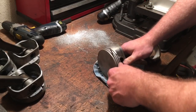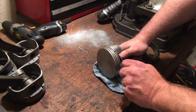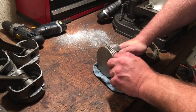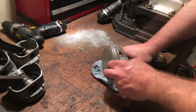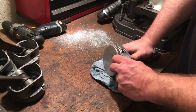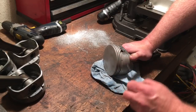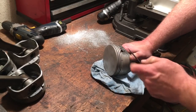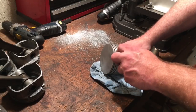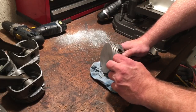This does two things: number one, it makes sure you have a clean piston groove to receive the ring; and also it makes sure you have no damage like a collapsed groove, burr, or anything that would keep your ring from moving freely. If you run into a little black spot, the tip of the file will get it out. Same thing here — start with the factory oil returns because you will find burrs coming up out of that factory oil return into your oil control ring land. Don't be dismayed, just clean it up with your little file.